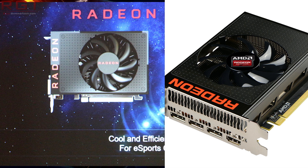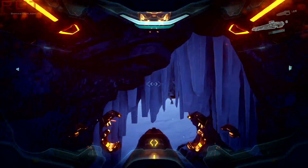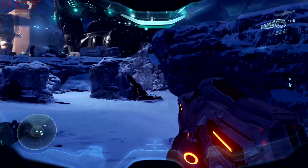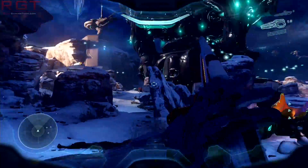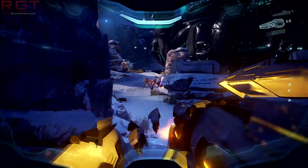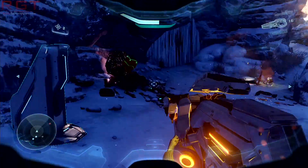It's a very reference-y design and honestly it looks an awful lot like the Nano, which isn't a bad thing — I don't have anything against the Nano design. It has 2 gigabytes of memory, which should be fine to power the resolutions this card is going to be capable of, and a 128-bit memory interface, which should be sufficient. Notably, it does not have a power connector, meaning it falls underneath the 75-watt draw that the PCIe slot on your motherboard can provide, which means it's absolutely perfect for folks who need a small, low-power card.